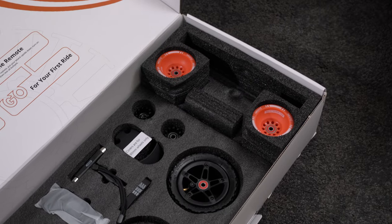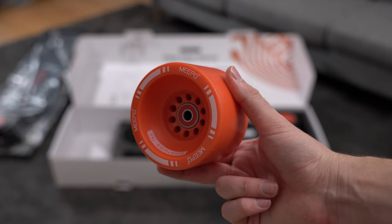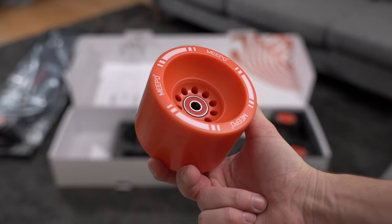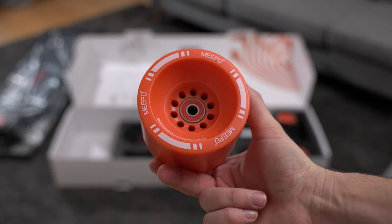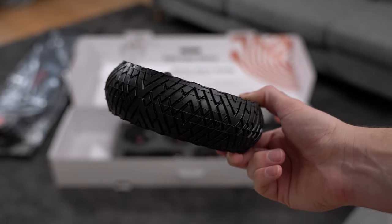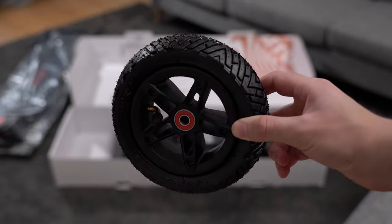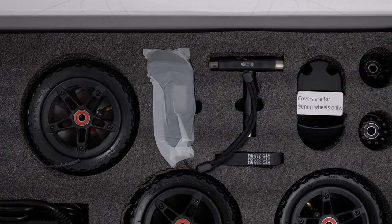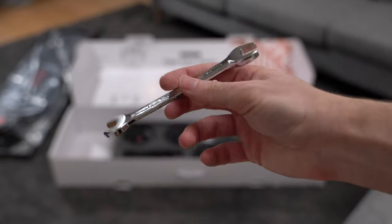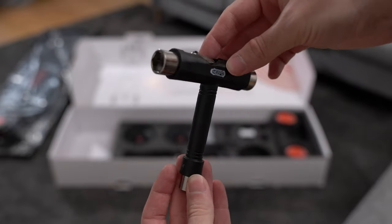As mentioned earlier, this is the 2-in-1 version, which comes with both the off-road and street wheels. The street wheels are 90mm 78A urethane wheels from ABEC, with Meepo branding. The all-terrain counterpart are 155mm pneumatic wheels, which offer better grip on grass and gravel at the cost of range and, to some extent, acceleration. We also find additional maintenance accessories like extra screws for the battery cover, a double wrench in sizes 12 and 14, allen keys for opening up the board, and of course the mandatory skate tool.